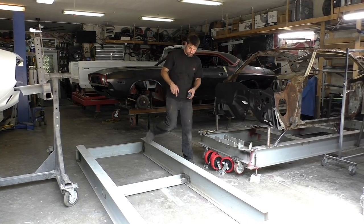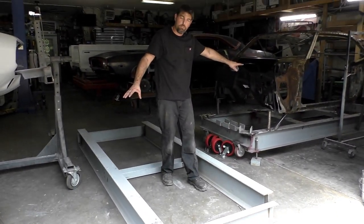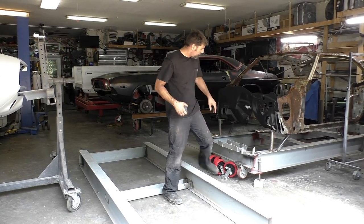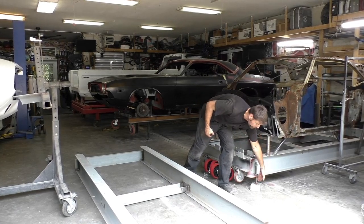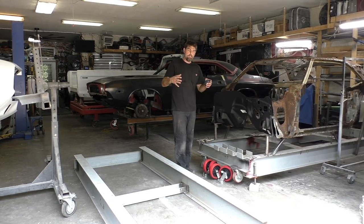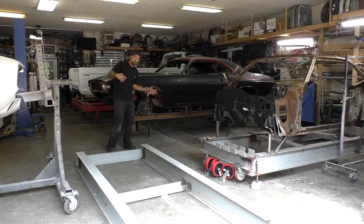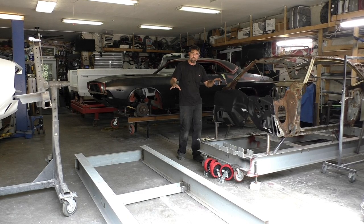I also got these cross pieces with these frame jigs. For all this metal to build two frame jigs, I personally spent $600 - it was about a year and a half ago. I also cut some legs out of it and I'm going to show you how we're going to go about installing the levelers. I think every frame jig really needs a leveler because the ground and floor isn't going to be level. As we're doing key suspension components and building these cars, trying to check certain frame height measurements, we want to make sure everything's level.